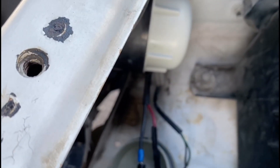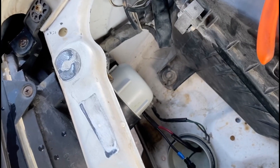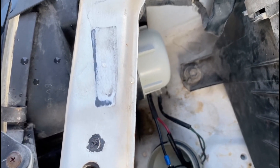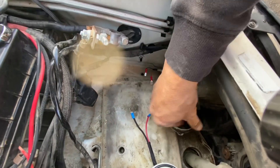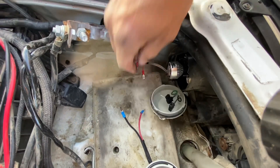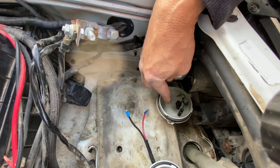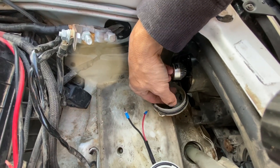Take a look at that cap — it fits perfectly. When you go to install the driver's side, make sure you disconnect the battery. Check out my video on part one of this where I change out the lights. This is the driver's side — it still has the OEM connectors. The other side I had to replace because one of the connectors was brittle and completely fell apart. These ones won't require heat shrink because they're still shielded when I put those spades in.